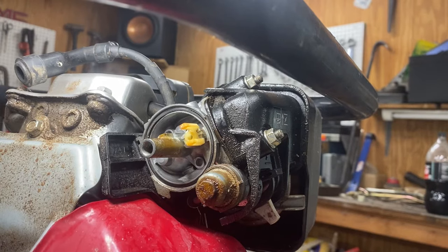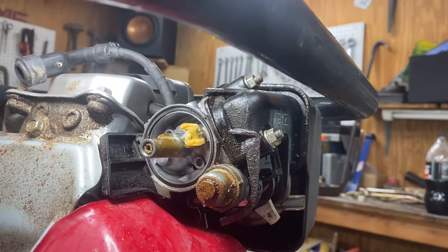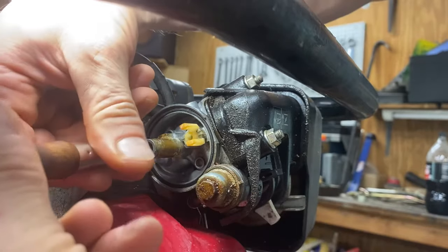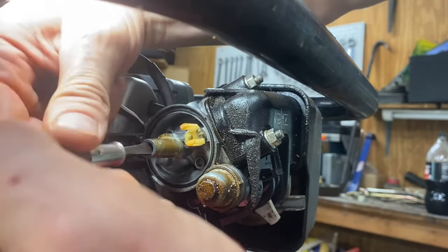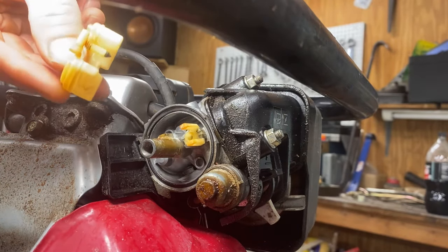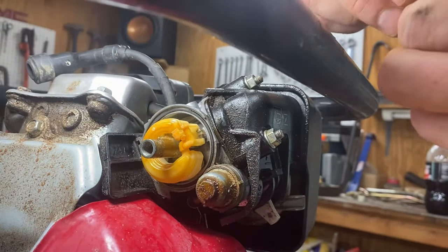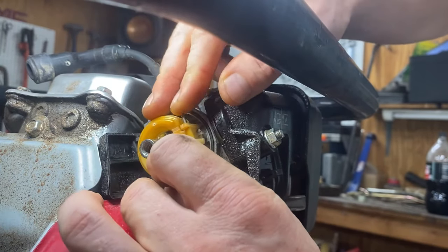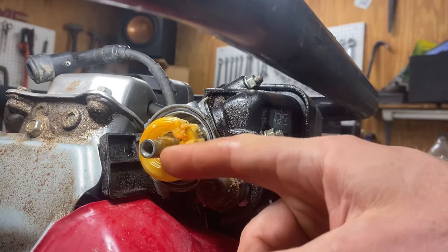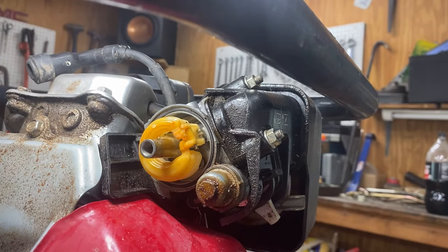So I'm going to go ahead and start screwing this sucker back together. Take your jet and make sure to put the notch side down - it just screws back into that hole like so. Slide it in there. One thing to point out - if you do have access to an air compressor with a little compressed air, that's always a good thing with these carburetors, just to blow through all the different holes. Make sure all your pipes are clean. Don't make that over tight because that is a brass fitting - it doesn't need a whole lot. Then you just go ahead and put your float in, make sure the needle point slides back into that hole. Drop your little float holder back in there. What happens is that ethanol gas just rots in there and everything gets clogged up in that main jet - that is 90% of your problems.